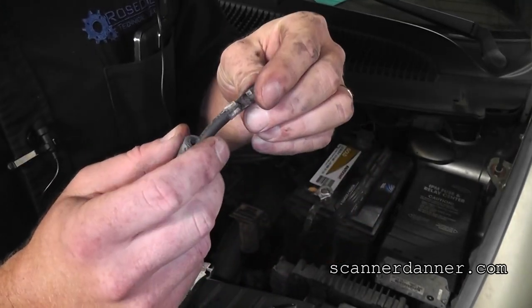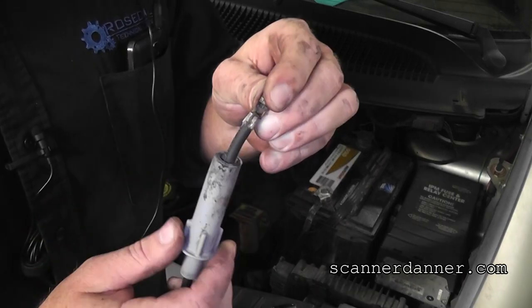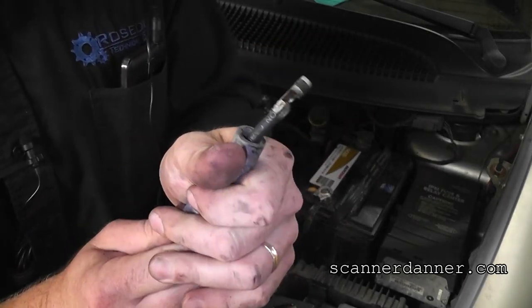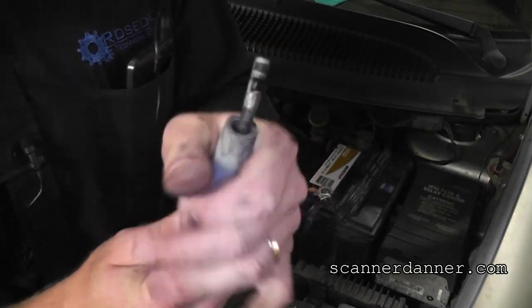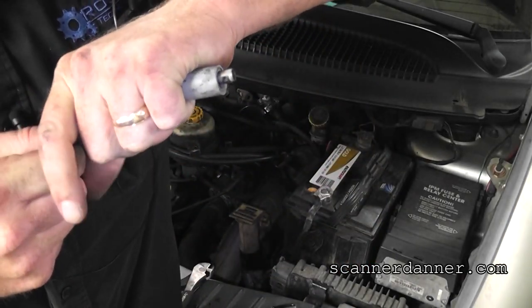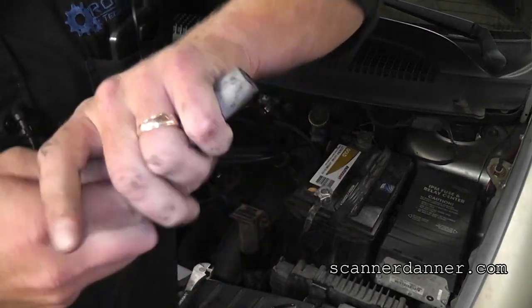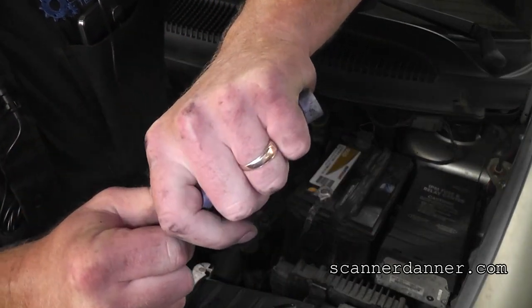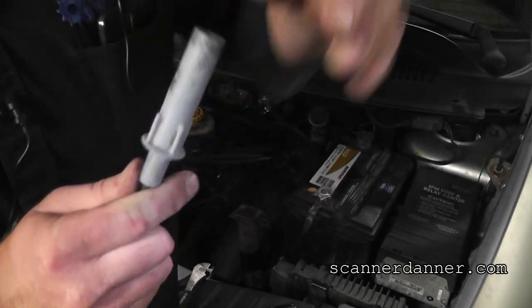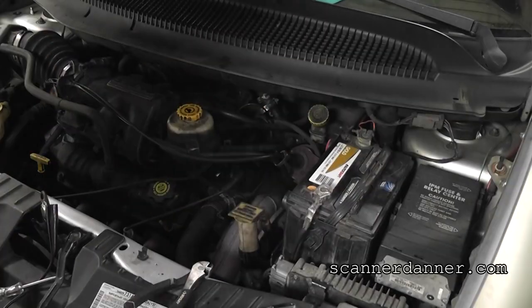Try to get these fingers hooked in and pressed down — that's good enough for right now. Pull the wire back down inside of it. It really should have had some dielectric grease here. Okay, that's far enough in there — let's get this back on the car.